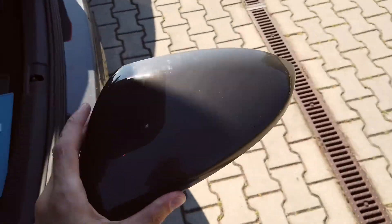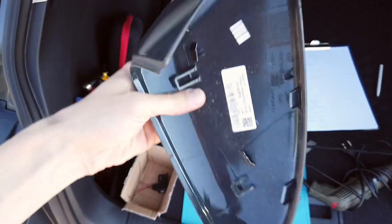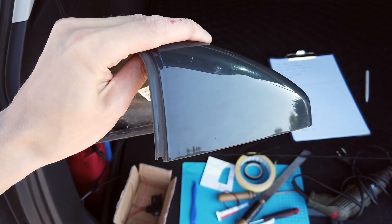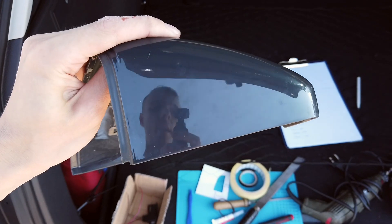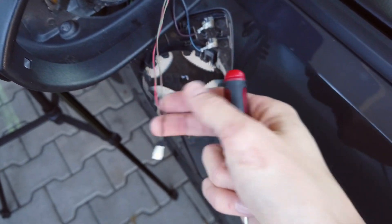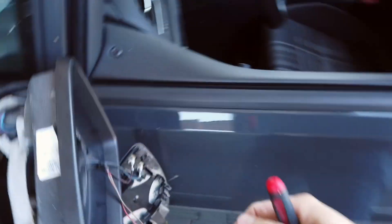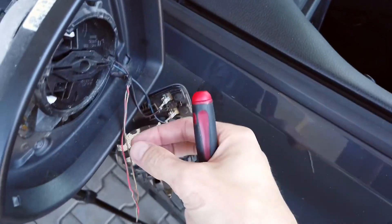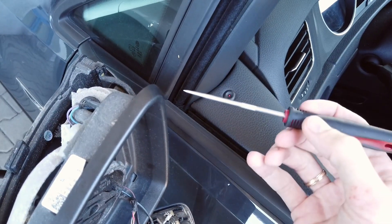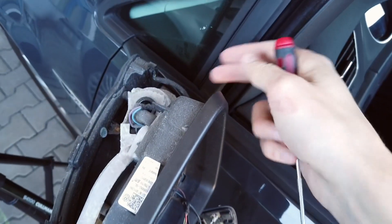And this is out. We are going to cut a hole here to fit this light, but if you are not comfortable cutting your original caps, you can buy a set of caps that are already ready for the blind spot monitoring indicator light — also linked in the description on Aliexpress. Since I'm not going to use the original indicator, I want to relocate this cable to the other side. You could add an additional light and wire it in parallel so both the original and the aftermarket light work at the same time, but I'm going to cut this because I only want the Passat-Arteon lights.